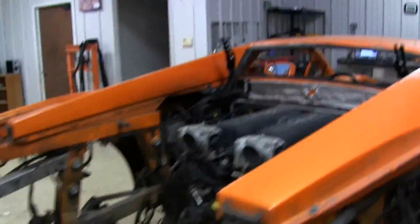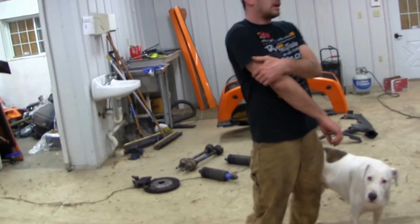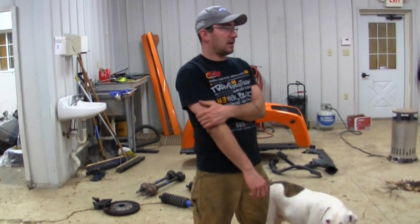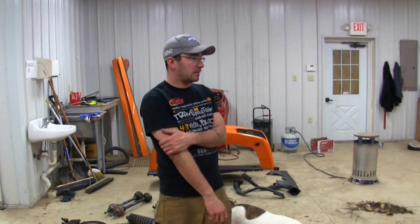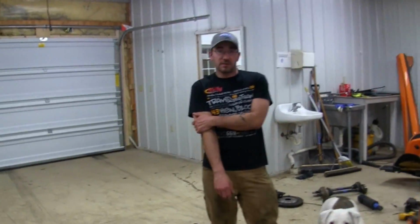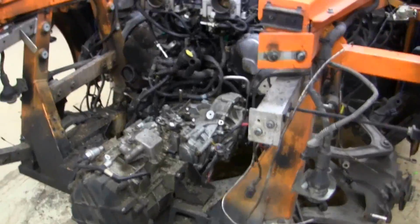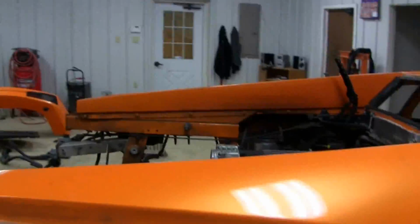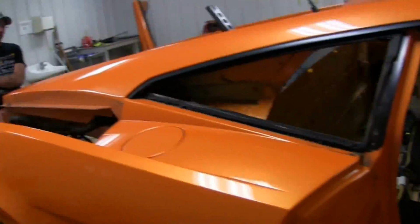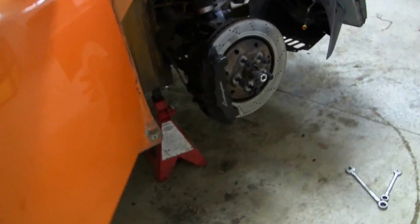Awesome. Where'd you say we've got the most weight getting removed from the chassis? Most of the interior, the airbags, the hydraulic suspension system. Going to smaller brakes, I'm going to save a lot of weight there. The rear calipers are probably 30 pounds apiece. I mean, they're huge and super heavy, and the fronts are even bigger. Okay. Going to smaller gravel brakes, I'm going to save at least 20 pounds of unsprung weight on each corner by switching to a nice setup. Probably go with something like AP Racing.